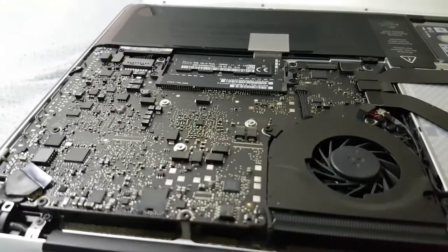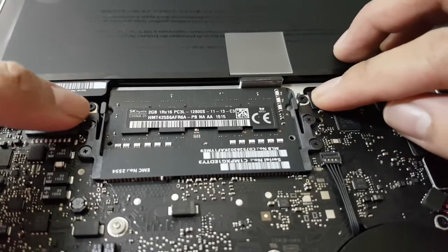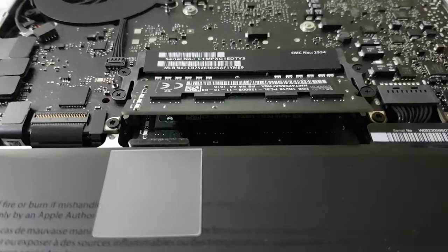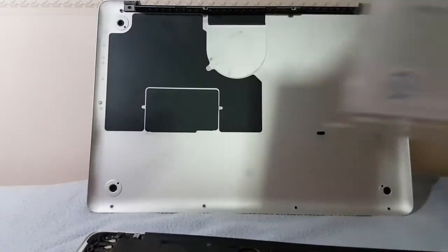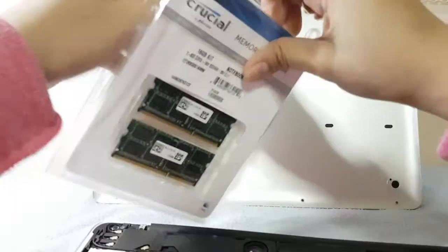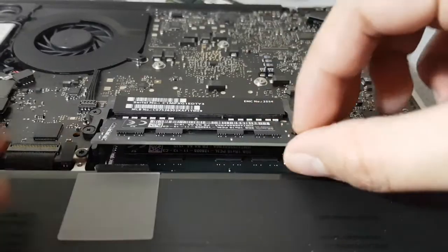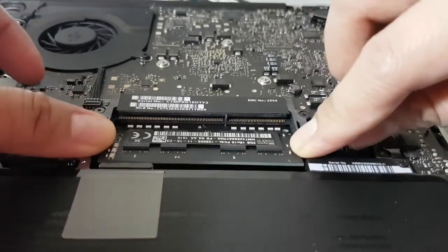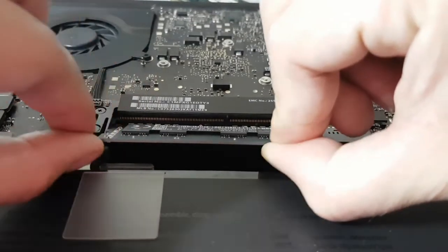What we're actually gonna be looking at is this part — these hinges on the side. The only thing you need to do is pull them apart and then the RAM card will pop out. There it is, popped out. You can see right at the bottom that there's another one. I have these two RAM sticks. I'm just gonna remove them — pull this one out, same thing, pull it out again.